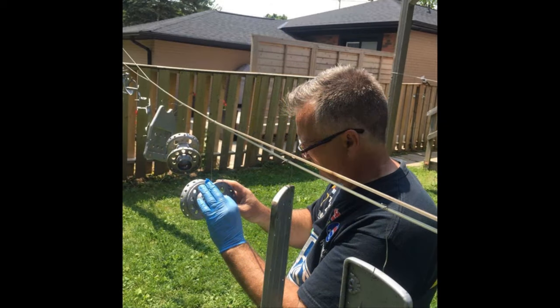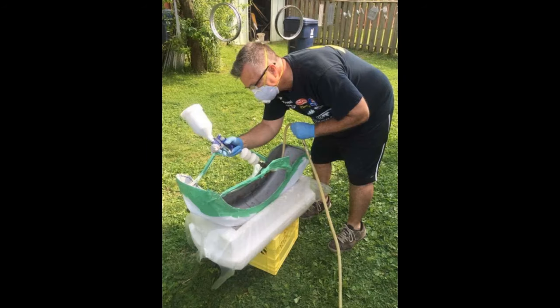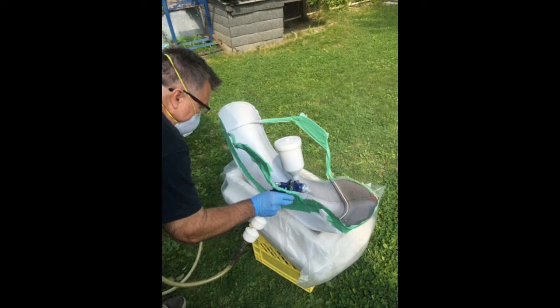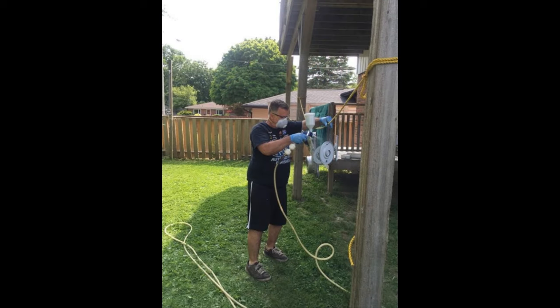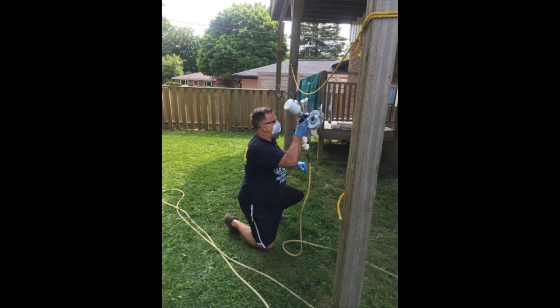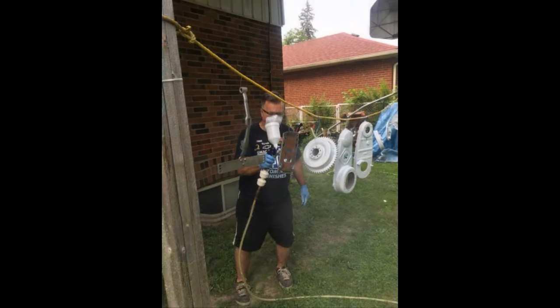Cleaning and dusting everything off with a tack rag, making sure everything's good. There was some brazing I had to do to fix that primary cover, just to clean that up. Now I'm starting to prime — all the insides of the fenders were sandblasted and now I'm priming. I used about two and a half quarts of primer, I was surprised how much. I put at least two coats of primer on everything.